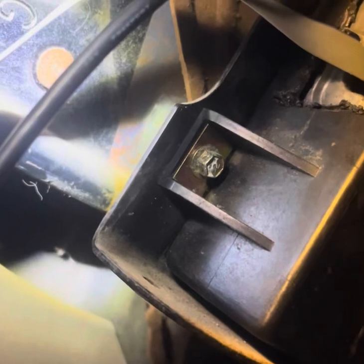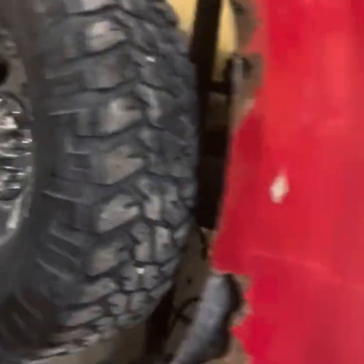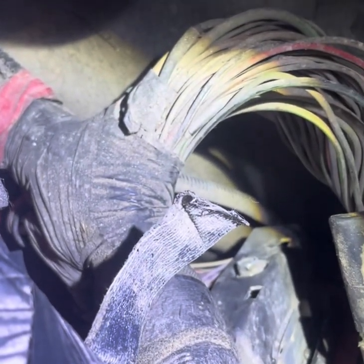Now that you have it reinstalled, put in the one, two little bolts — the ones you took out earlier. Remember the X on the PCM goes towards your fender and the little circle goes towards your driver seat. Make sure that brass ground clip is in there. Then push your wires through and come back up front to that 10 millimeter bolt you took out earlier, make sure your wires are all clipped together, then tighten down that bolt and you're good to go.